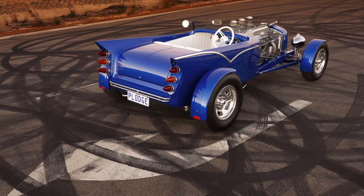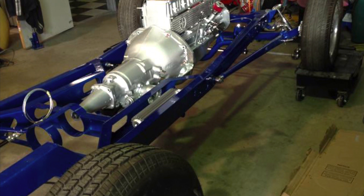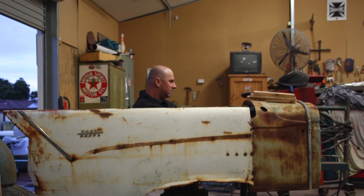It's a bit hard to tell from these photos, but essentially we started with an original 1927 Dodge cowl and 1959 Chrysler Royal rear quarter panels. We started with the original Dodge chassis, but then ended up fabricating one to the same specs with just a bigger kick-up in the rear, and we used a Chevy 235 six-cylinder that we had kicking around.